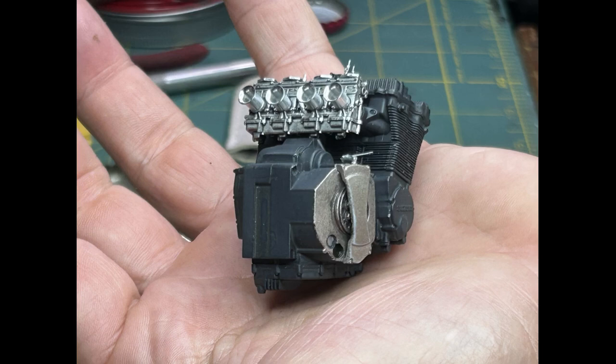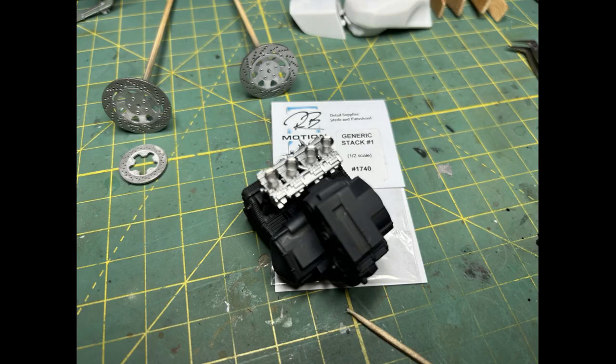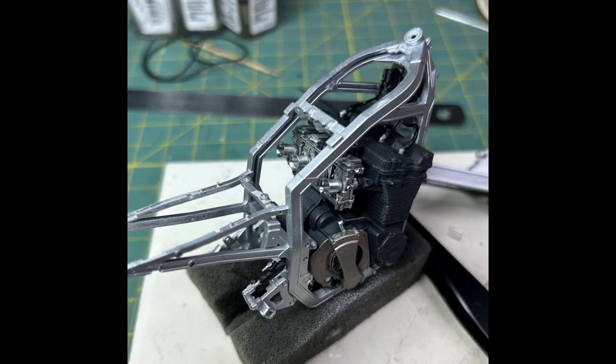It was later modified. One of the other modifications was getting rid of the stock airbox. I think that was one of the first things that got thrown out when people bought this bike. But the stock airbox gone, I had to find some velocity stacks, so I found some from R&B Custom and ordered those. They're actually spun aluminum. They look really good. Fit perfect, right where the airbox would have been. Didn't have to make any modifications at all.